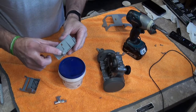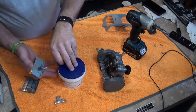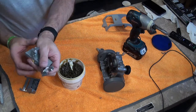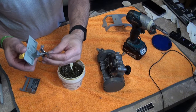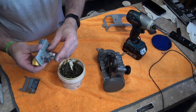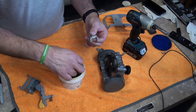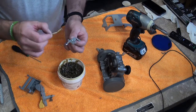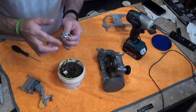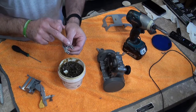Alright, so we're back. I'll put an i-card above for the video on how I repaired this if you haven't seen that one. All you're going to need for this repair is a bit of grease. Slot this on first — grab your new one. I will put a link in the description of where to get these from. Slot that on there — that slots over there and that works like so. Take that back off again and put a little bit of grease just on here to help it slide in and out. Now less is more — you don't need loads. Just a bit on there and a bit on the bottom, and that's it. If you put grease on the wrong area, you're going to cause issues.